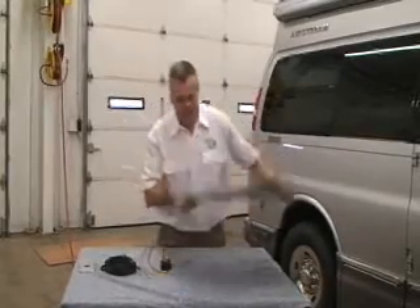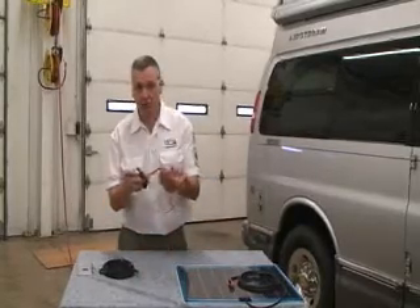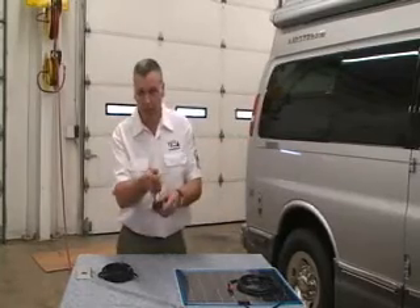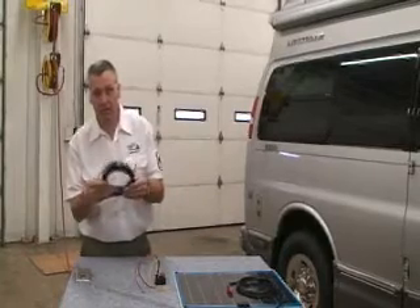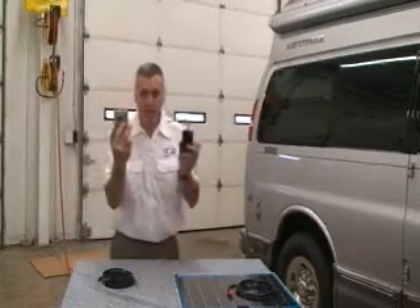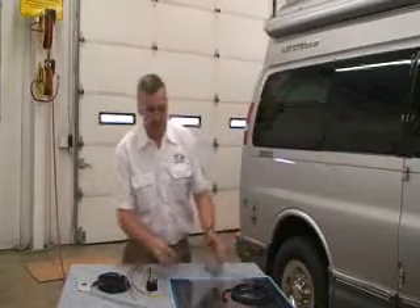You can see it's wafer thin and sits right on top of the roof. Then we have our charge controller, which is going to get mounted in the back around the positive and negative bus bars. Next we're going to be installing our CAT5 communication cable, which gets connected between the monitor and the controller. The solar panel gets mounted right up on top of the roof, right in front of that fan.